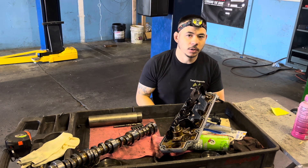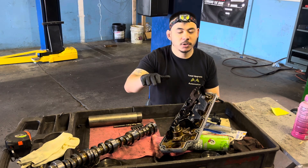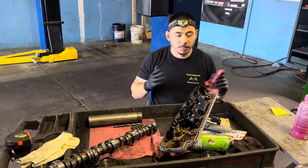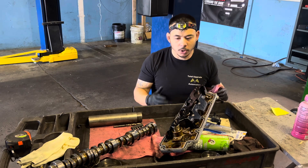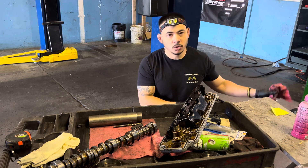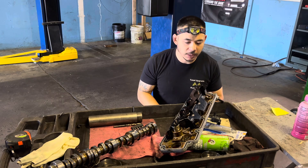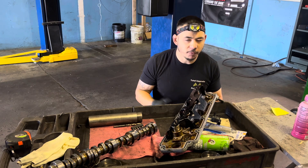That was causing that cylinder to set a misfire code. Research says the system should turn both rockers off — neither the intake nor exhaust valve should be opening and closing — but in this case oil only flowed through one. Going forward, every single time we do this job I would recommend replacing this oil manifold along with the camshaft and all the lifters. You may also need to do a couple of sensors like the MAP sensor, or you can try to do a delete on the system. If you get rid of this it will function normally, but you have to update the PCM software.